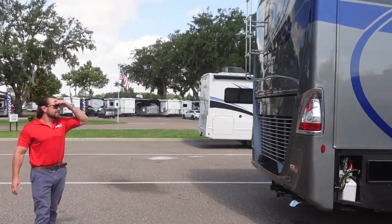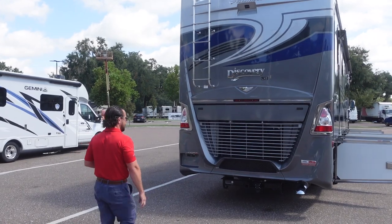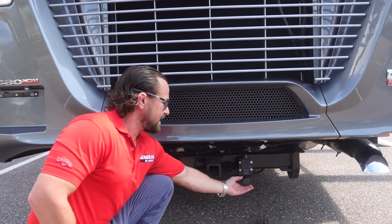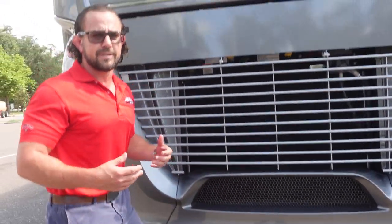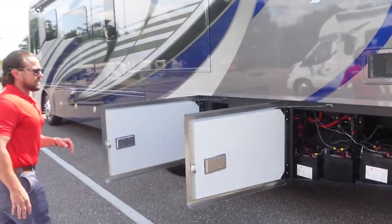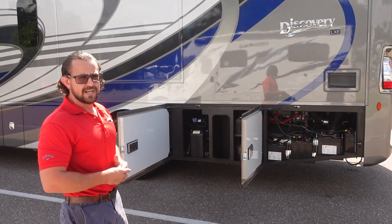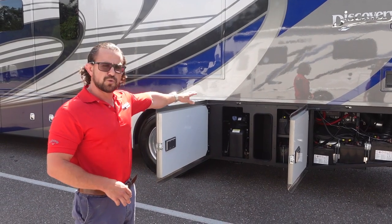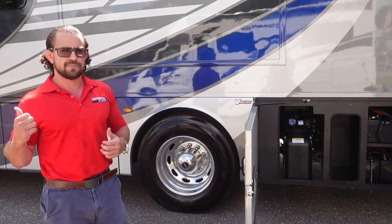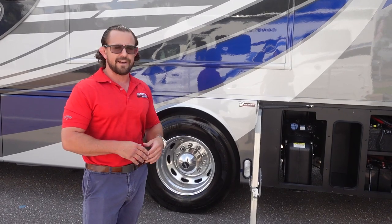Walking around the back, there's a nice motor cap with a streamlined look and roof-integrated awning systems. The hitch is a 10,000-pound unit with a seven-way plug for towing, plus Freightliner's Brake Link option for easy air-assisted braking hookup. The rear radiator frees up space for six house batteries tied to the inverter and solar systems, plus two 12-volt chassis batteries. There's also a 13-gallon DEF tank and a 100-gallon diesel tank, so you can cover many miles without frequent fuel stops.